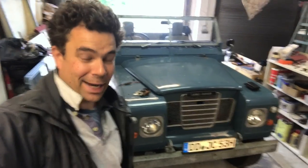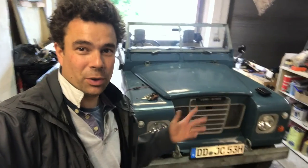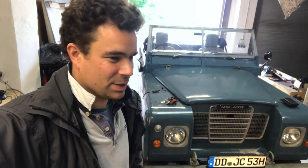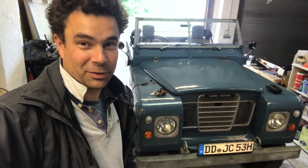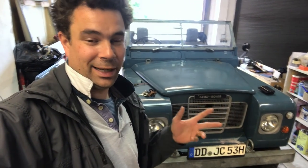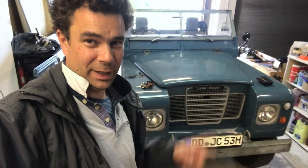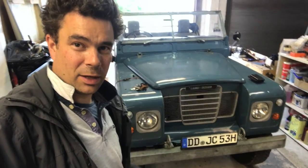The more I drive the car the more I definitely need to change the oil, because I haven't done it since I put the new oils in - from the videos that was probably 2016 or 2017 - so really not good. I haven't been doing much mileage but it's obviously the moisture that gets into the oil. So the plan is engine oil, EP90 gear oil for the gearbox, transfer case, overdrive and axles - quite a lot of work. I may also need to reset the tappets. The car is cold so I'm going to go for a quick drive to warm it up first.